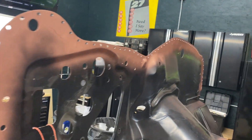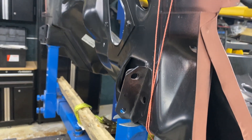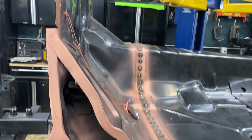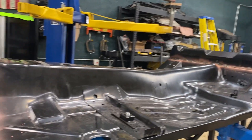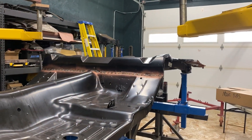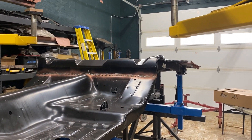Firewall is back in, all prepped, holes punched — haven't punched the others yet since I'm not sure where they need to go exactly. I welded it up and managed to tilt it back a little bit with a very small shim. It wasn't much but I think it'll help. That part's done — some quality grinding time coming up. Next I'm going to move on to the mini tubs and get those situated.